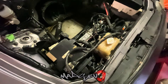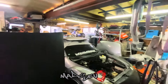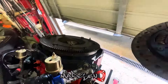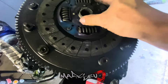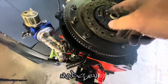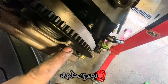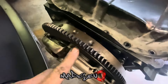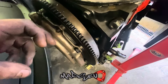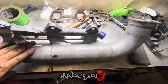Shouldn't take me too long. Actually, before I do any of that I need to put the clutch on — next thing is I need to find the clutch. That took a little while to find; it was in the boot of the RX-8. Parts are just scattered everywhere, but this clutch is still all right, not too bad. Just goes second-hand — send it, should be right. I've got the clutch on. Just noticed on this flywheel there are these little nubs for the clutch which actually raise it up a little bit. If anyone knows what that's about, can you let me know? Because on the other engines I've done these nubs weren't there — we tried to put the clutch on and just couldn't disengage it off the flywheel. I'm not 100% sure what that's all about, but if you know, please let me know.